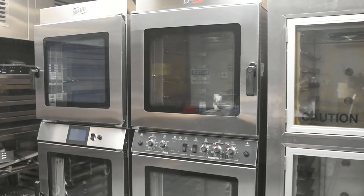NewView warns against using oven cleaners in the oven. Once inside the walls, these cleaners are very difficult to remove and may cause your oven to smoke or emit noxious fumes until they are rinsed out or burned away. You will need to completely disassemble the oven interior in order to flush away any remaining cleaner.